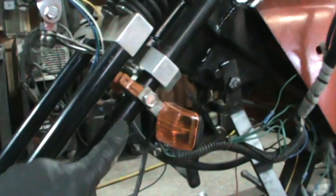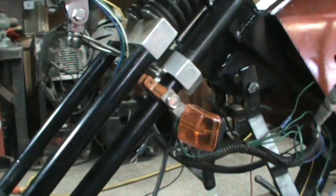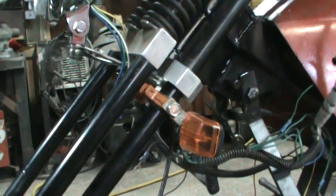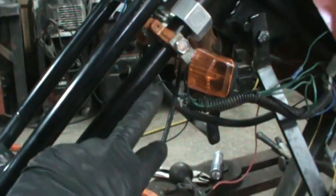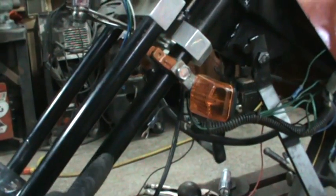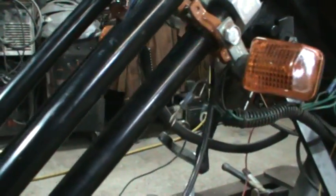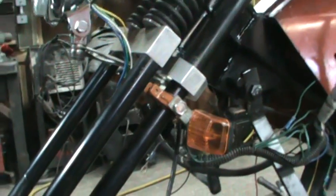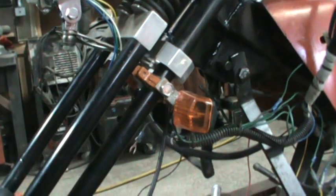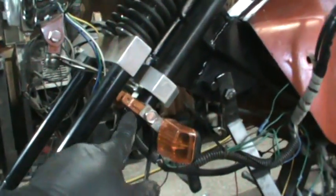And I just took some tire tube rubber and wrapped it around the suspension so that it can kind of take that gap up. I had a choice of, I think one was 3/4 and one was 1 inch, but this is 1 inch diameter, but they're going by 1 inch plumbing, which is the ID, not the OD. So it's, you know, like probably like 1 1/4 or so. So that should work, and that rubber's not gonna hurt anything. Probably give it a little bit of cushion anyway. Only thing I might need to do is make a ground jumper go into it, because I won't get ground across that.